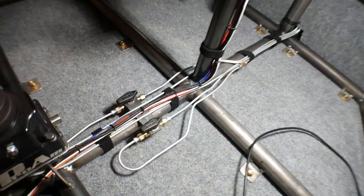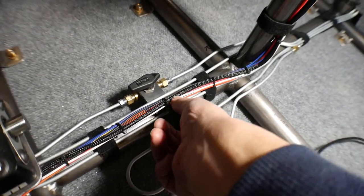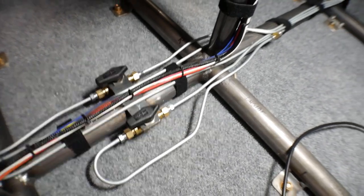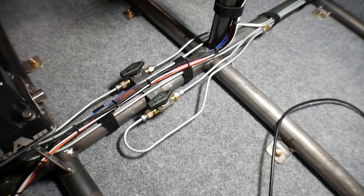So at that point, I tore down Wratchet a little bit more and I changed the parking brake valves that I had. I had them mounted up where it went up and down and I had the plugs there. Well, I took all that off and I mounted some just ball valves on the floor because a lot of people said that the soft pedal I was having probably had something to do with those. So I mounted those down low and I think I'm pretty happy with those. I had to drain down the brakes and I had to change all the piping and then I had to re-bleed everything, so it was a lot of work. But it feels better than it did before.